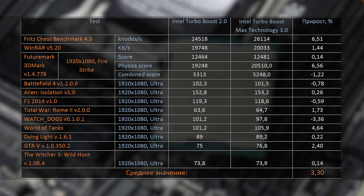Finally, we present a summary table comparing activation of Intel Turbo Boost 2.0 and Turbo Boost Max Technology 3.0. The Turbo Boost Max driver is required for the latter — without it, you can only observe Turbo Boost 2.0 records. After testing, results are quite predictable: you can get an average increase of 5% in synthetic tests and data encryption, and less than 1% in games.